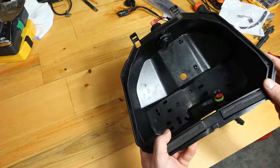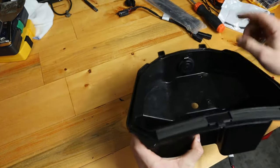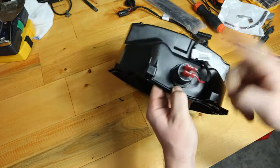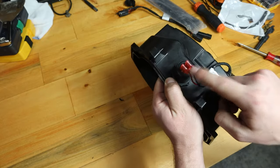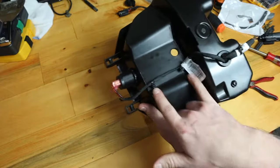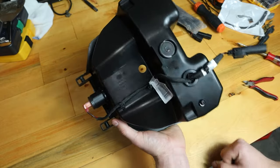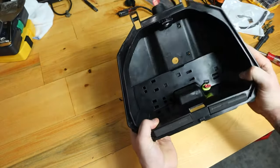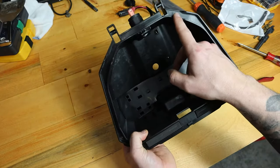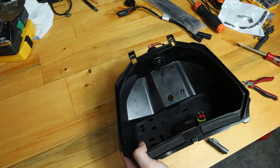We are done with that portion, at least. This is your phone mount heater plug. You have your USB power outlet right here. It's labeled, so make sure that you put your wiring on correctly. We have some zip ties to secure the wiring harnesses to the bottom side of the glove box. The next step is to place a foam gasket on the back side of this, and then we can place the glove box extension on top, and then install the glove box.